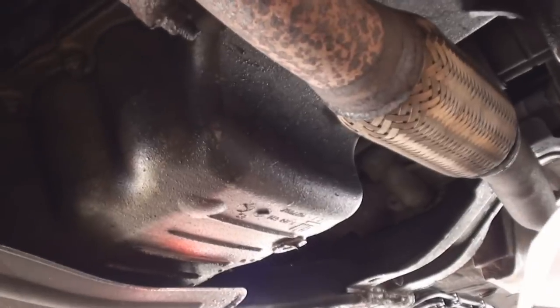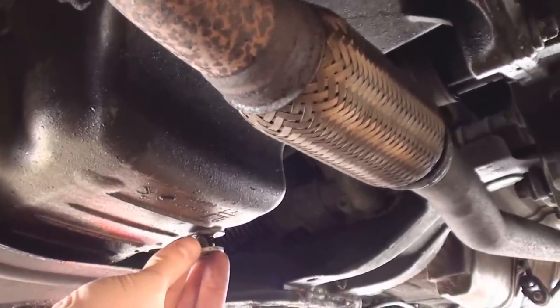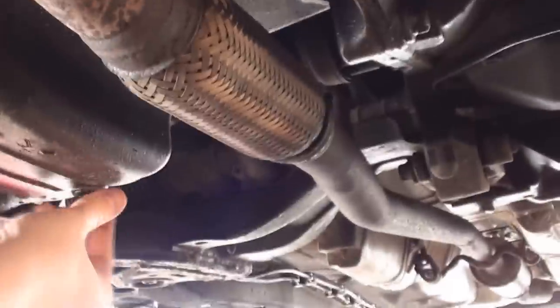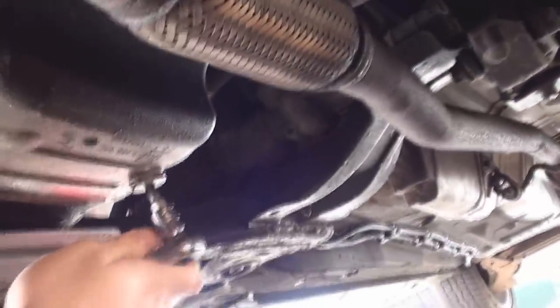When the oil is finished dripping out, you need to give it a quick wipe to get off any oil residue, and then it's just a case of putting the bolt back in the sump. Once the sump plug is back in, just make sure you get your T45 and nip it up nice and tight — that way you're not going to have it drop out on the road, lose all your oil, and knock your engine.